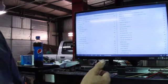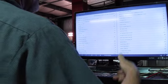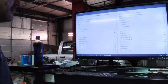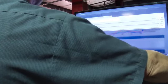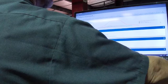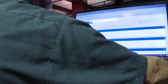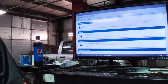So we know the variable valve solenoid has nothing to do with this one. It is the rocker. Our desired and actual are really pretty close to the relationship they were commanding. So we know to overlook the so-called Sure Track, replace the variable valve timing solenoid, is what they say. Let's display codes again. We'll go back and show you that. They say replace the variable valve timing solenoid, a common fix. Replace VVT solenoid, no. Rocker arm valve timing control. That's the area we're looking into, and of course the TSB that is listed for this code.